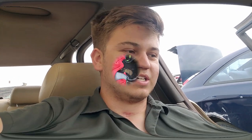I have been totally freaking out about the sunroof glass. I'm at a junkyard now — I thought you were going to have to take apart basically all the stuff up front, literally take the whole headliner out and replace it as an assembly. But I just watched a video of a dude who shows how to do it and it takes like three seconds, so I undid the nuts off these studs and it's gonna come right out. I think I'm actually gonna be able to do this.